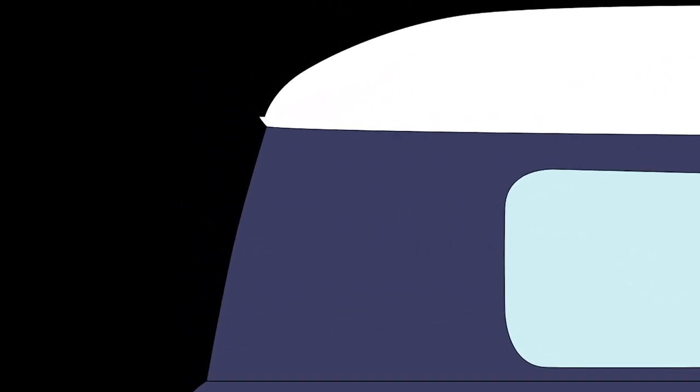The channel runs around the perimeter of the roof. And from what I'm seeing, each panel has a small inward-facing lip. The channel sits over this lip with a small overlap to the outside. The panel and channel are then spot welded together from the inside. The roof sits on the channel with an outer lip that's spot welded from the outside. My plan is to remove the inner spot welds and separate the roof and channel as one.